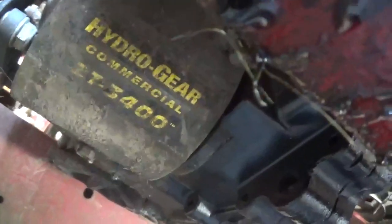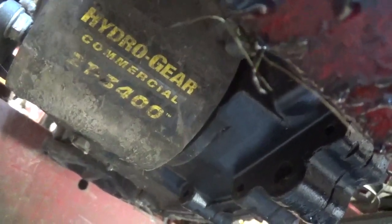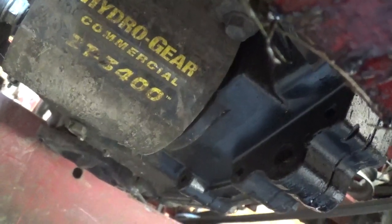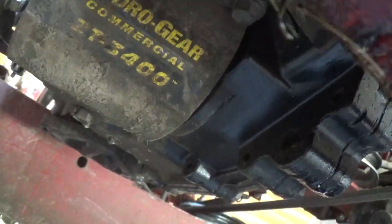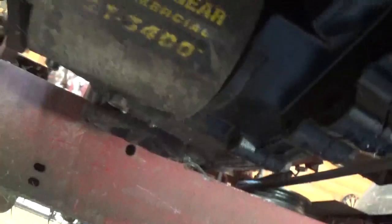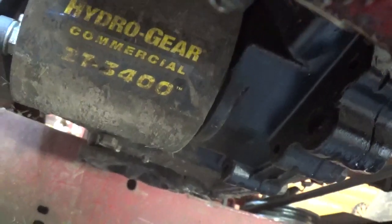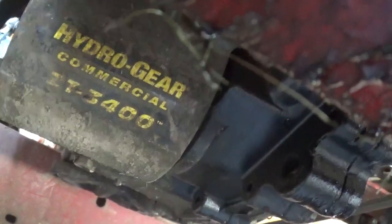Right from the back side of the Ferris, on the right hand side, you see that right there, that's the sign that indicates that's the cover. That's the cover for the filter that runs the transmission fluid. And that's how you find it. That was hard to find. There's only three nuts that are holding it together. I'll take it out and look at the filter on the inside.